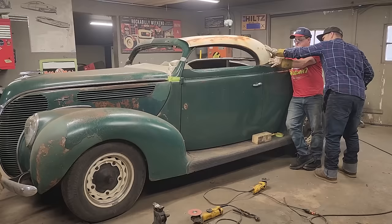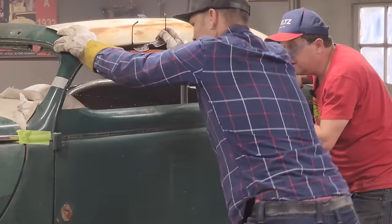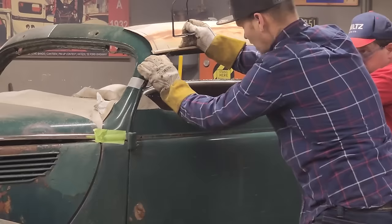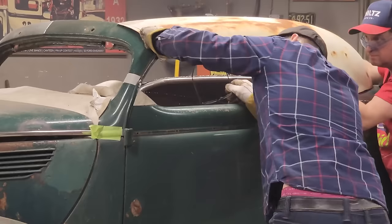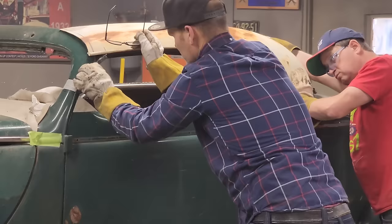No. I could fill that up. I gotta make up my mind what I want to do here. That's all. It's curved and it's gotta kind of roll flat. Well, we've got a thing going on here. This is probably gonna have to be built out and changed here on the post because I can't make two posts line up that don't line up. I can weld them together, but if they're not the same shape, they're not the same shape. And I can bring that and cruise that right up into there and smooth that off. This could be filled in. I think that's what I'm gonna do.